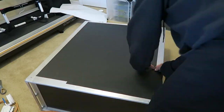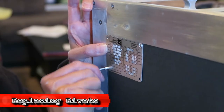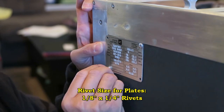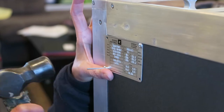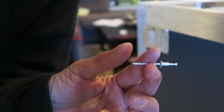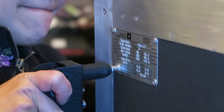Here I am cutting off and removing the extra wrap. Before I reveal how it looks, I need to put the ID plates back in. Some of the holes are really tight and my 1/8 by 1/4 inch rivets would simply not fit. Don't do this - hammering in the rivet won't work, don't hammer the other side of your rivet. Sometimes using the riveter to push in the rivet helps.